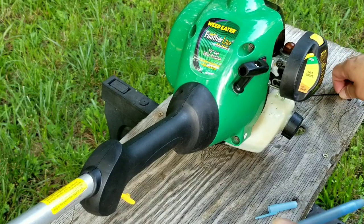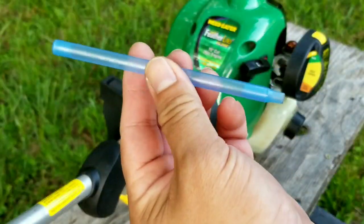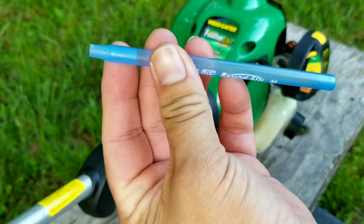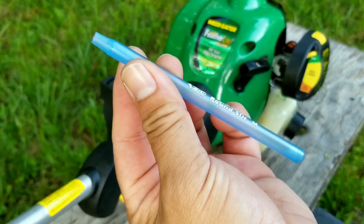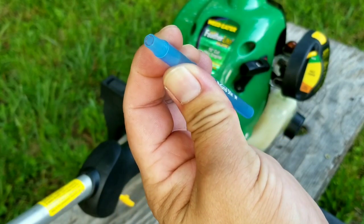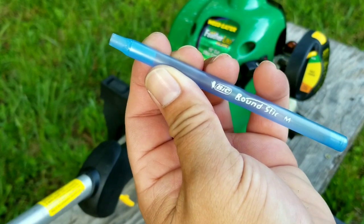We're able to hear that the engine changed both times when I added fuel. The first time the engine speed increased and it ran fine, but when I added more fuel the second time it actually slowed the engine down. Just as a side note: if you end up adding a lot of fuel you're going to need to increase the idle speed to compensate for it.